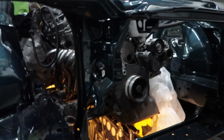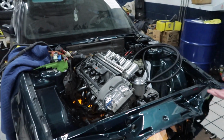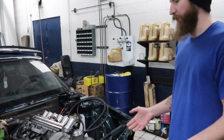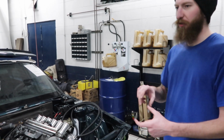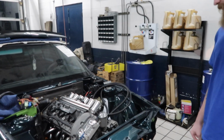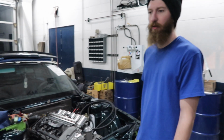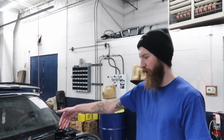Obviously, with that you need the oil pan pickup tube, and I bought a modified oil pump. Not high pressure or high output, but modified where the shaft's hardened and it has a double D shape instead of splines to keep the gear from shearing off, because these pumps have problems with that. That's where this S54 gets more confusing than putting an S50 here. Actually no, that was optional. The only thing you really have to do is unbolt the long pickup tube and put the short one on it. So you don't have to necessarily do what I do.